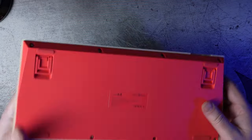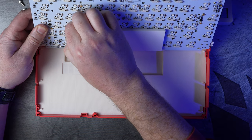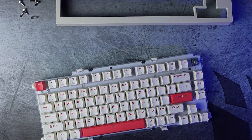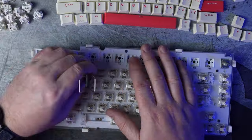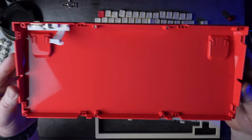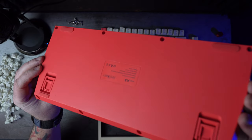We're going to put our best foot forwards and get this one apart to see what's inside. As usual with gasket mount keyboards, we just remove the eight case screws from underneath and lift off the top case. From there, you carefully tilt up the plate and PCB assembly to unplug the daughterboard from the PCB — the daughterboard allows for the vertical movement of the gasket. In the bottom case you can see that nice-looking silicone case dampening pad. I don't think this will help much with sound unless it sounds hollow without it, which is quite likely.